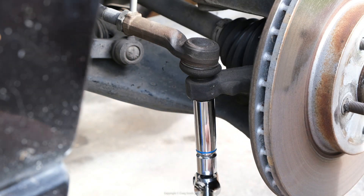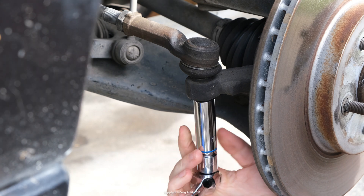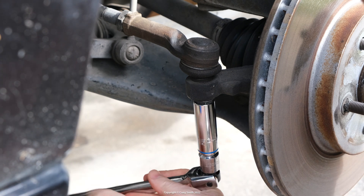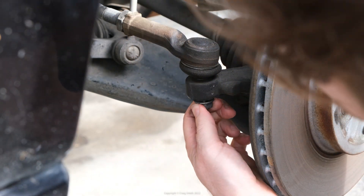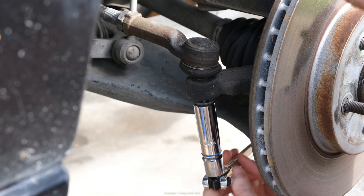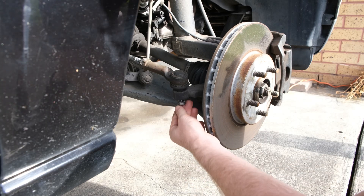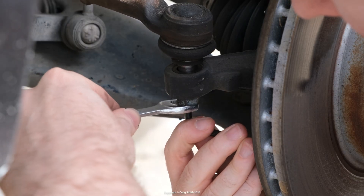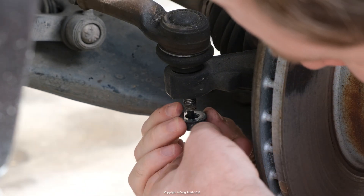I'm using a crow's foot attachment here with a breaker bar, because it's attachable to a torque wrench later for tightening, and it's less likely to do any rounding damage to the nut if it's on really tight. Then undo the nut on the outer rod ball joint spindle — helpful to have a deep socket for this, otherwise you'll have to use a spanner. Turn it down until it's flush with the threaded rod end but leave it to help absorb the hammer blows. Smack it hard until the taper fit pops out of the steering knuckle, then you might need a little hex key to hold the ball from spinning as you undo the nut the rest of the way, and the rod will come free of the knuckle.